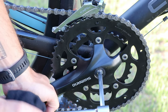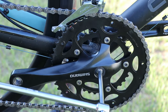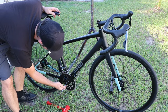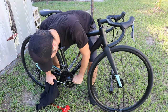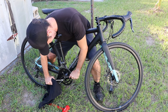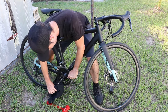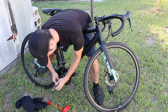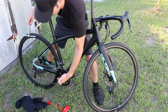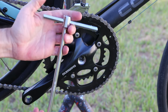I think it's fractured or something — it really hurts when I put pressure on it. Oh wow, that's super tight. I'm going to try a little bit of a different approach here, taking the bike off of the stand. I'm thinking I can maybe press down better. Okay, it moved — that's good. I really didn't want to break this new tool I just got. There it goes — wow, that was way tight. That just removes the pressing bolt; the crank is still fitted onto the spindle. Thank goodness I had this long T-shaped 8mm Allen key, because I don't think I would have got enough leverage with the normal one.